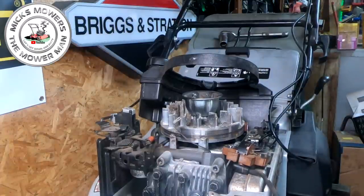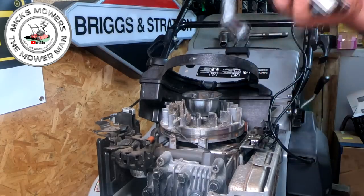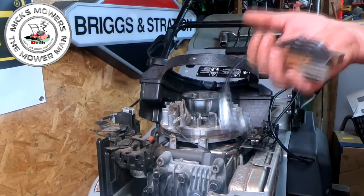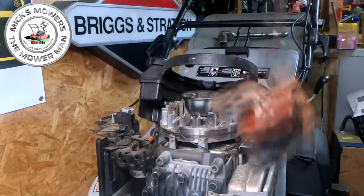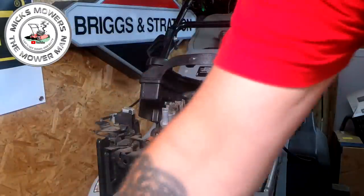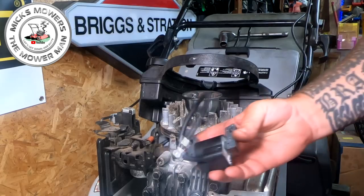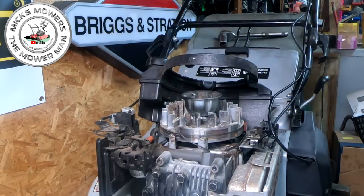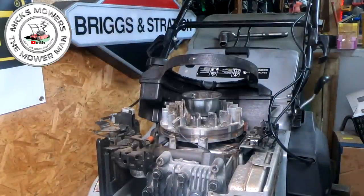The coil does sound a little bit high to me. I've done a big video on how to test a coil and it's done very well in views. But this coil could be reading okay right now yet actually failing when it gets hot — that's the issue. It won't start when it's hot, and to my knowledge you can't actually test these for thermal breakdown. So I'm not going to bother. I picked up another coil for 20 quid — for what it costs, it's not a lot of money and I'm not going to lose sleep over it.